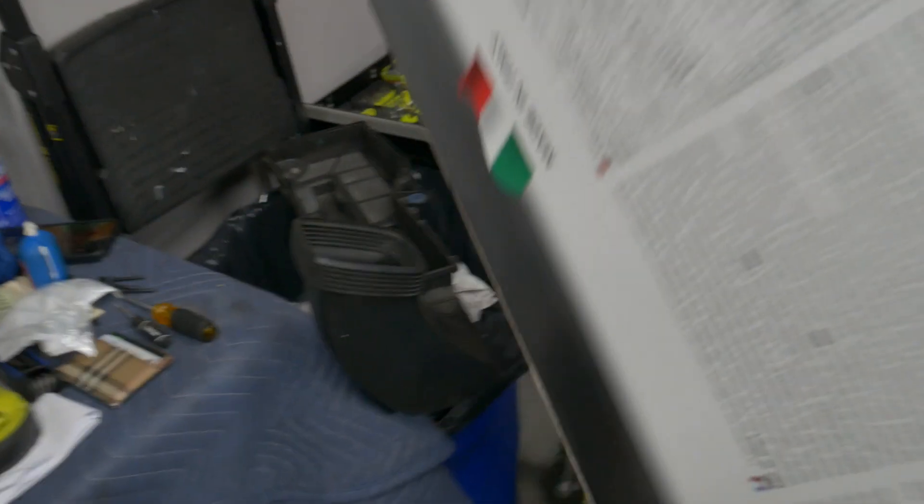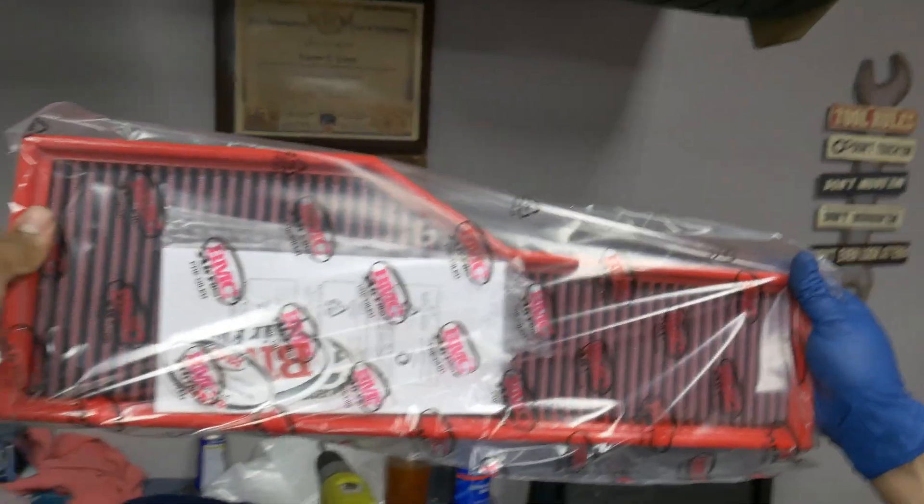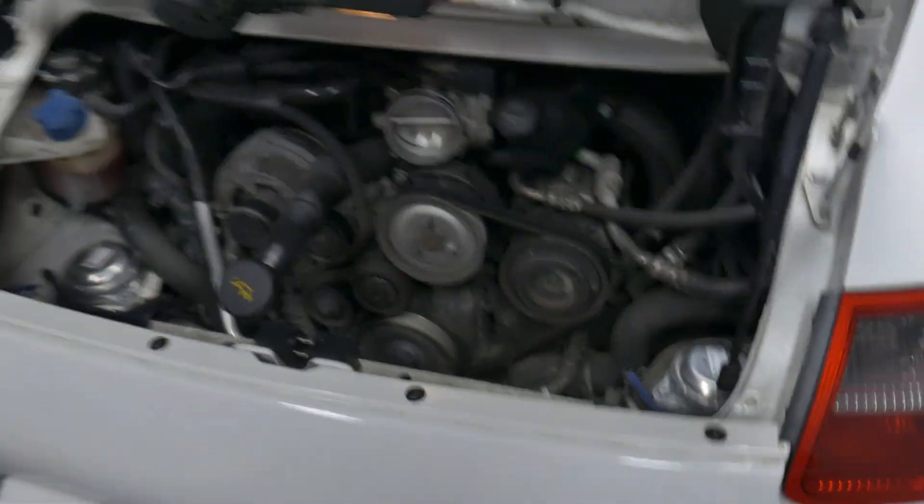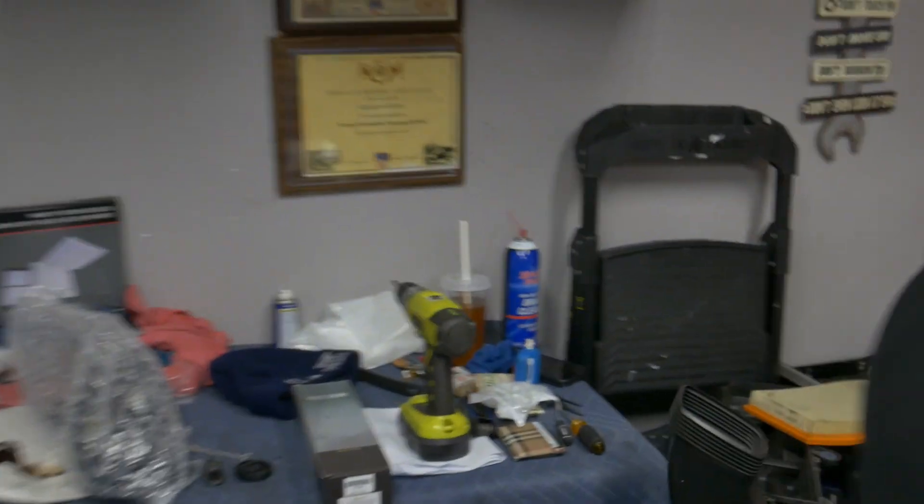While we have the air box out, we're putting in a performance air filter. We might get a little bit more induction noise, maybe probably not, but I think we get a couple of horsepower just from this filter upgrade. It took a bunch of T20 screws to remove around the edge, but it's out. Here's the new one — it looks good, so let's drop this bad boy in. And we already installed that little clip, so the air box won't rattle anymore.